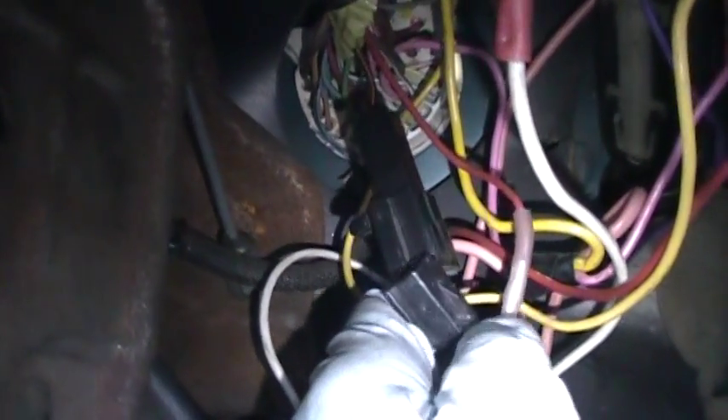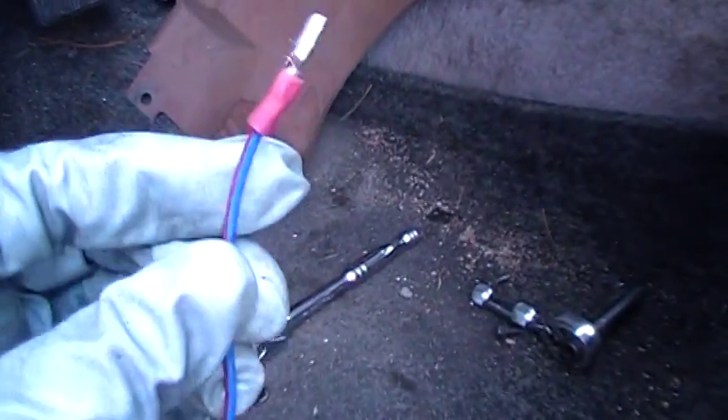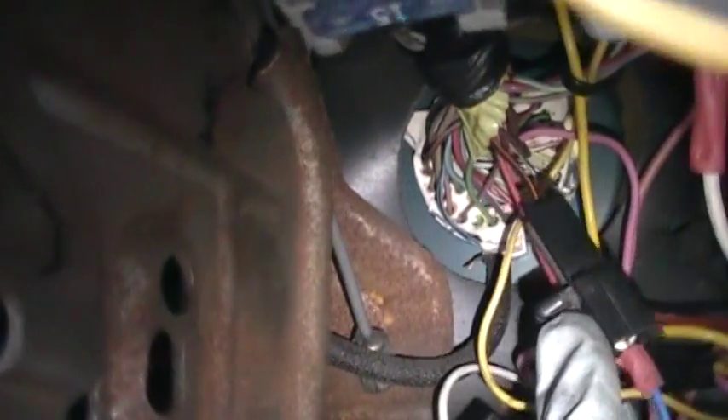What you do is take your screwdriver and release the tab, pull this out. You take the side of the connector with the black and the orange wire — it has a male spade lug coming out of there. I made a little tool, which is pretty simple: a female spade lug crimped onto a long wire. I'm going to connect this spade lug right in here, onto the male connection. It doesn't have to be perfect, it just has to stay. I've connected that wire up into that upper connector with the black and the orange wire.